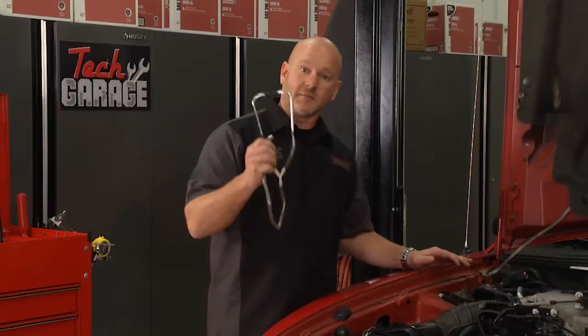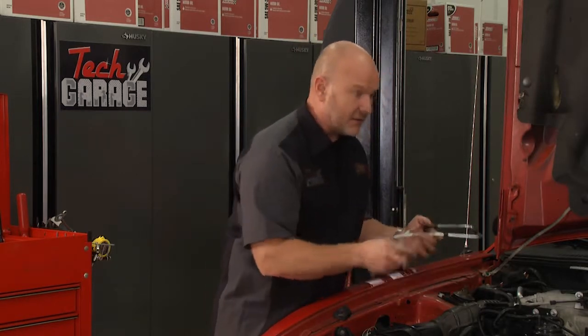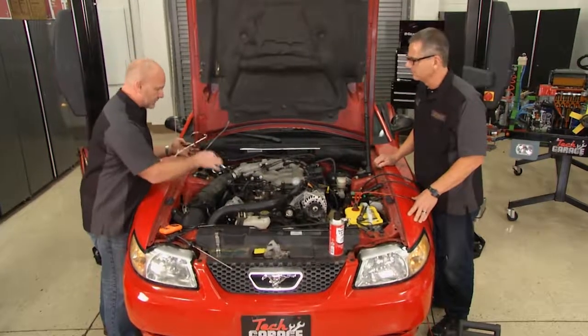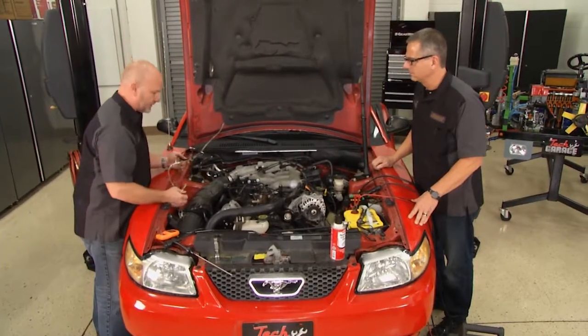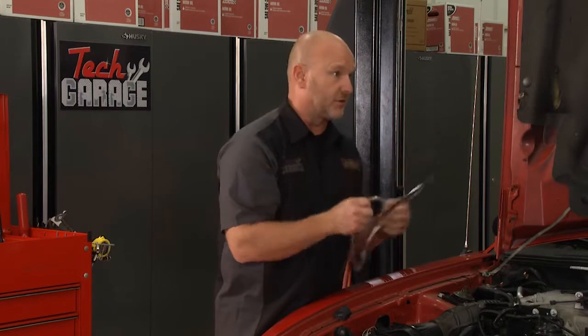I do. You know what? You've got the mechanic's stethoscope. Everybody loves this, right? You take the probe out and have the engine running. You can actually listen around. Since it's a lean code, we could listen around the engine here, maybe around the intake manifold, and there would be an audible difference if we could actually hear the air leaking through this mechanic's stethoscope.